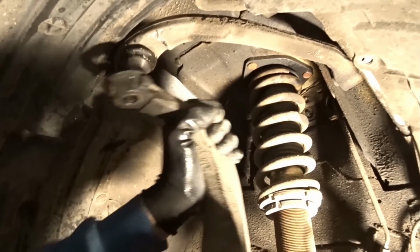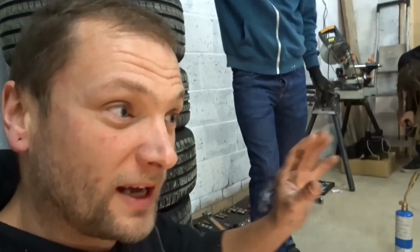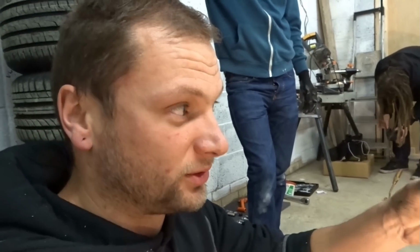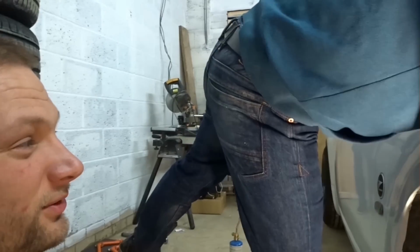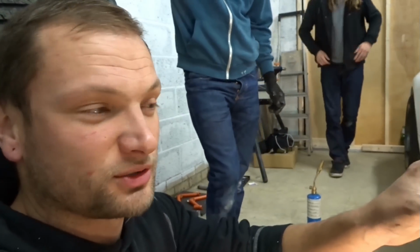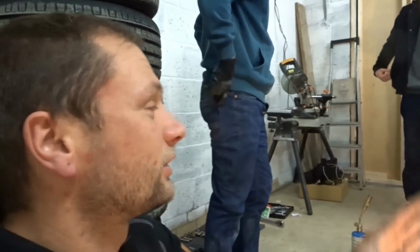It's free. Right, so now we are going to make up the assembly on the floor. We're going to basically get them exactly the same as factory, so make it up to the same length as factory, then just dial it in a little, because we're going to go for about negative 5 camber, drift style. Inner bolts first. But we've got to do inner bolts first, which surely they can't go any worse than that.